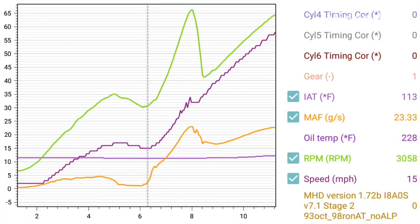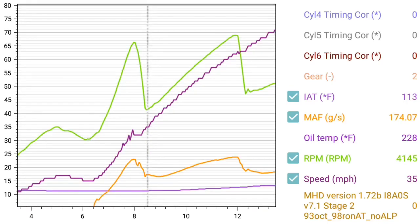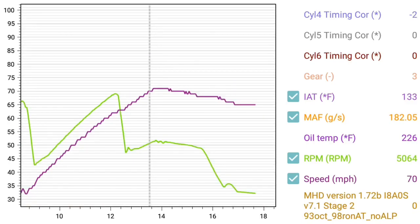There was basically no change in my data — the intake air temp and the mass air flow grams per second remained the same. I thought that one of these would have changed, but basically no difference at all. My first audio was of the intake without the scoops, then I went to the exhaust — love the burble, it always sounds good — and that is a stock exhaust with catted downpipes but the catback all stock. The third clip is with the scoops in. I really didn't notice any difference in the noise at all — it didn't sound better, it didn't sound worse — and I didn't see any performance gains. It obviously wasn't on a dyno, those were road runs, and if you put it on a dyno it's possible that it builds a little more power, like a couple horsepower maybe, or it could even take away a couple horsepower.